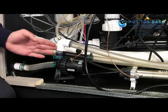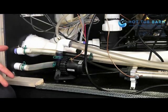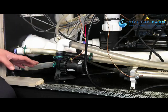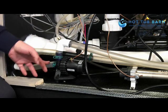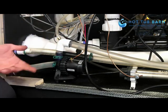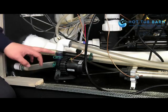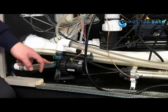I'm now going to change the Watkins silent flow circulation pump. Again, it's an easy job. You may find it easier with no water in, but if there is water in there, you can find some corks to block off your pipes, or if there's no water in there, then it's quite easy to do without it. First thing I'm going to do is take the pipe off the top and off of the side,